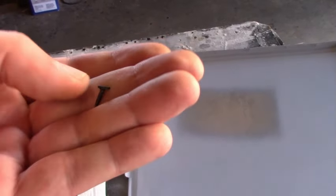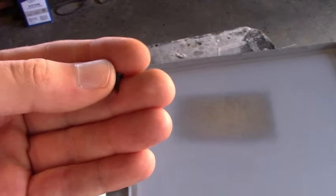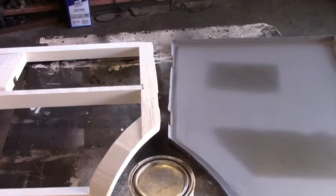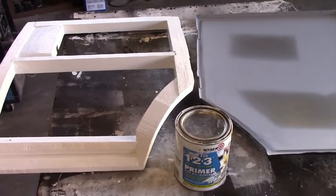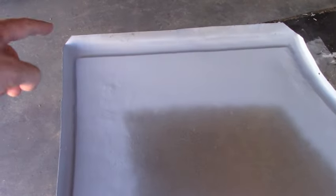For assembling it for now, I'm using upholstery tacks, just because they hold and they're pretty easy to remove if we need to adjust it. When it comes time to assemble it permanently, there's a different kind of nail we'll be using and I'll show you then. Now the bottom of the door, as you can see, has no nail holes and it's not finished — for the time being we're going to ignore this, but I'll show you how I'm going to install it later on.